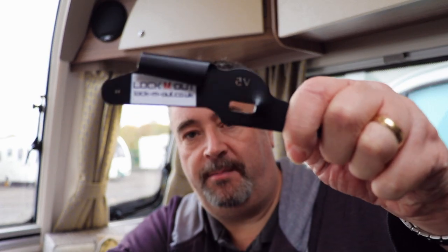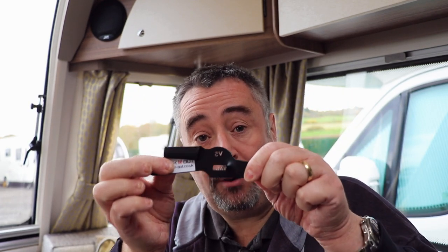I'm thinking for people who've got children who do like to get out of the caravan — it is something that happens quite a lot. Because of the design of these, they've got a big hole in the middle, and that means you can install something like a cable tie, or a wrap, or something around it to hold it onto the latch. Which means if that's held onto the latch, the latch can't open and they can't get out.